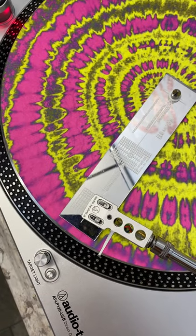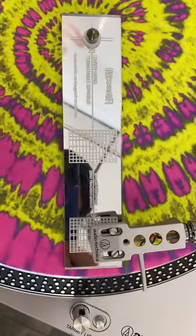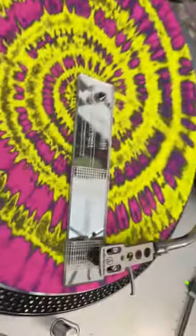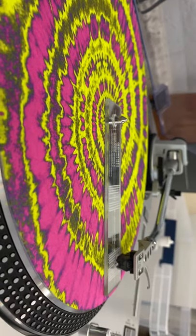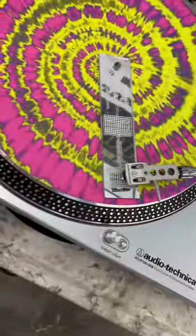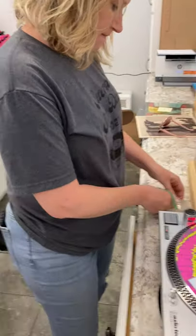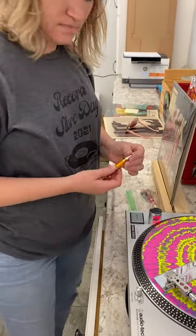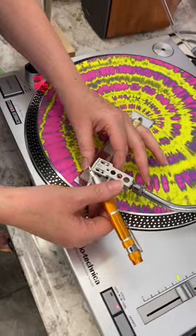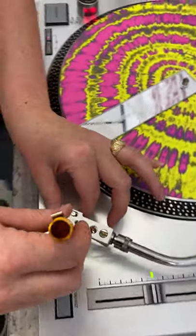If you bring the camera down here and look at the needle from this viewpoint, you'll be able to see that it is crooked. So we're going to fix that. You'll need a small mini flathead screwdriver. It's helpful to do this every time you change your needle or if you're having issues with your machine — like you guys said it's skipping, and we just changed the needle.